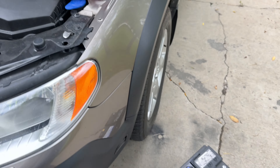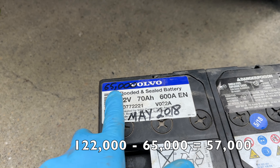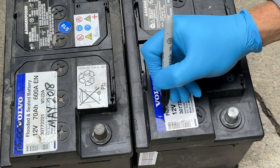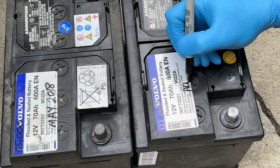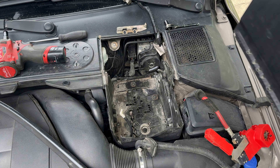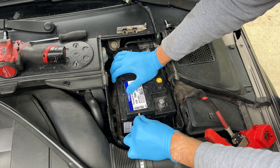The original battery is five years old, installed in May 2018 at 65,000 kilometers. Simple math — in five years I put on 57,000 kilometers. What I like to do is use a marker and mark the current mileage and date, so it's easy to track the age of the battery. Next replacement will be in 2028 — if we get to live to the date! Put the new battery in, reconnect the vent hose and the bracket.